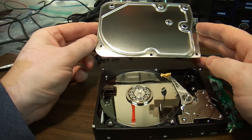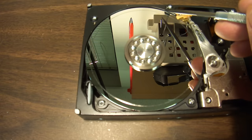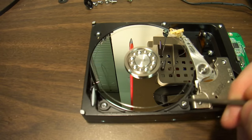There is only one way that the air can move. As you can see, there is a big problem with this hard drive. This ring was left by the heads. When this drive fell down, the heads crashed onto the surface. This drive is history.